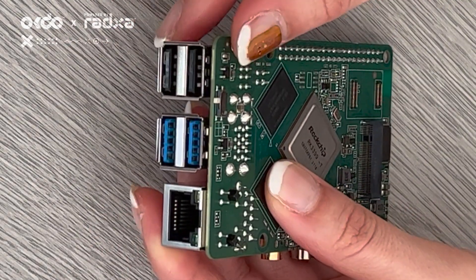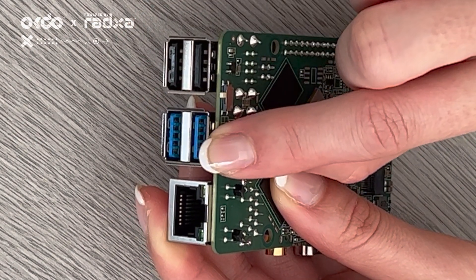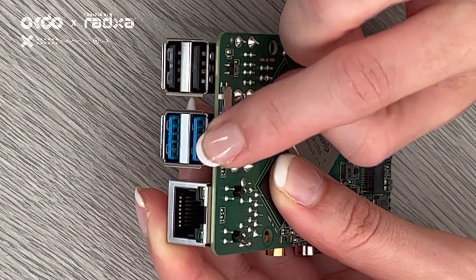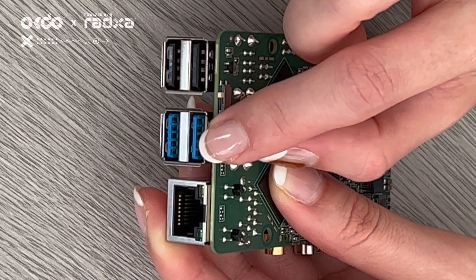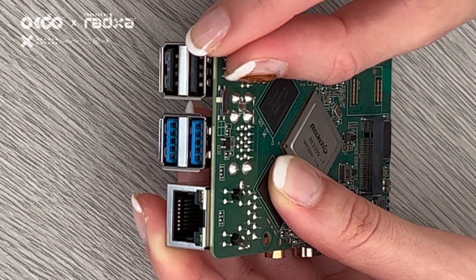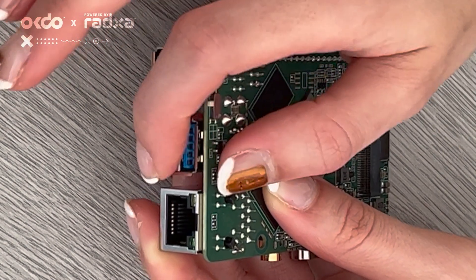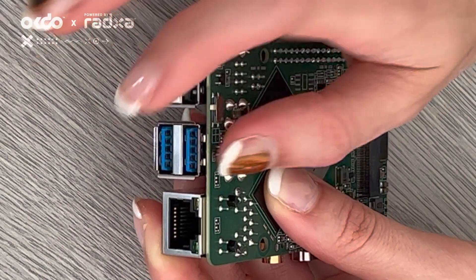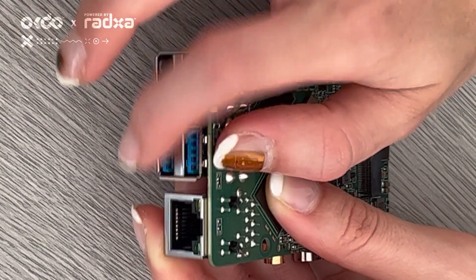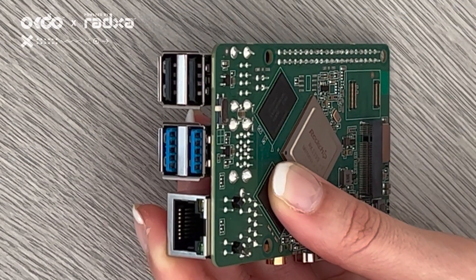You will see here there are four USB ports — USB 2 and USB 3. The USB 2 ports and the lower USB 3 actually share a regulator which can provide 1.44 amps of current. The upper USB 3 port has its own dedicated regulator. So if you've got a mobile phone you want to power, you can use that dedicated port so it is not shared with anything else.